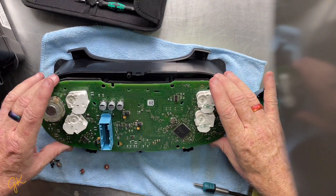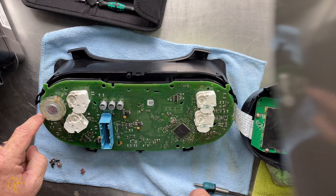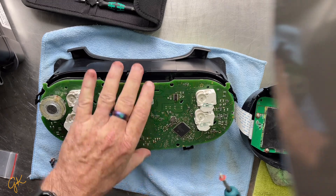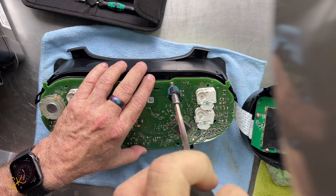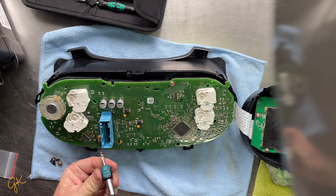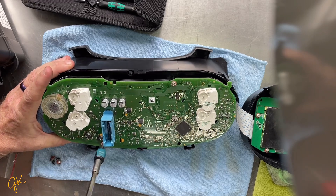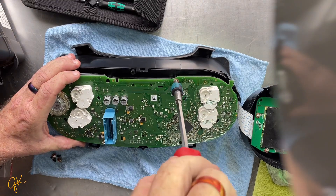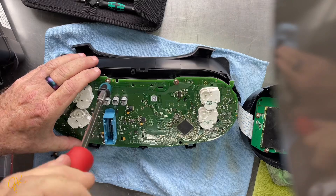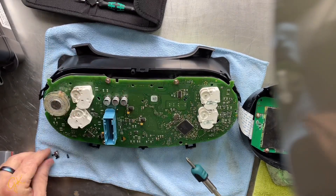The motherboard needs to be placed on like so and then screwed in. The instructions I received showed a screw here and a screw here, but the problem is there's no screw hole there — there are four here and four screws total, so we're just holding the motherboard in place. I don't like winging it — one of the reasons I'm putting these instructions up is to prevent somebody else going through the same pain. The self-tapping screws just need to go all the way in without compressing the motherboard. Note the screws have little fiber insulators to make sure they don't touch anything on the board. Make sure the motherboard itself is central to the holes.